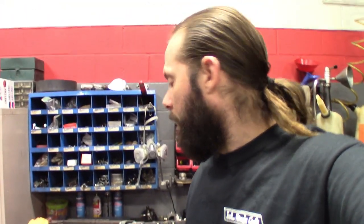So like I said, just coming in real quick on a Sunday, putting in a little work on this Equinox build. I gotta get in the work where I can. But if you guys watched that engine teardown video where we pulled the head off, when we pulled those valves out, I showed you how to use the right size socket with a hammer. You pop it down a couple times, get those keepers out, use a little bit of grease so they don't go flying. But they actually make a tool for that.